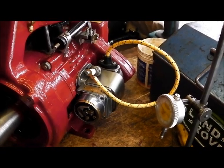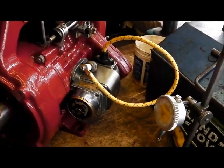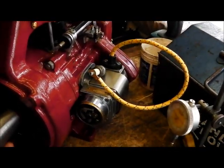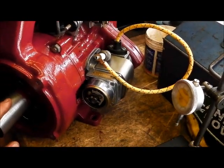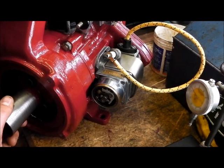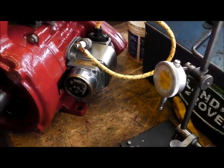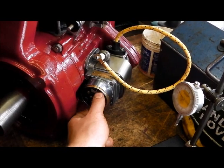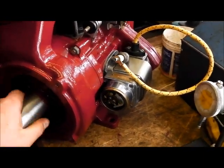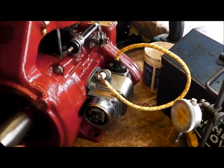I tried turning it the other way - of course no spark either. I thought about it, then took the cover off so I could see which way the mag was going. When testing the mag I'd been turning it clockwise at that end, so all I had to do was reverse it. Not a complicated job at all - I took the points rotor assembly out, removed that bolt, filed off the inbuilt woodruff key, and that meant I could put it on there loose enough to just turn it round a little bit at a time to tune in the spark until it was best. Now I can rock the engine in the right position and it will spark. So it's really, really good now.